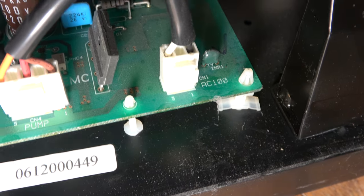So it seems more likely that there was just a random failure. Possibly the voltage on this was starting to fall very slightly, and it just got to the point that it was starting to take a little bit of current, and then it got hotter and hotter and hotter, and it got into a thermal runaway situation. Because there's no resistor anywhere, so it's just going to dump the entire output from that if this starts to conduct. So you could argue, I don't need that component at all. I don't actually think I do.